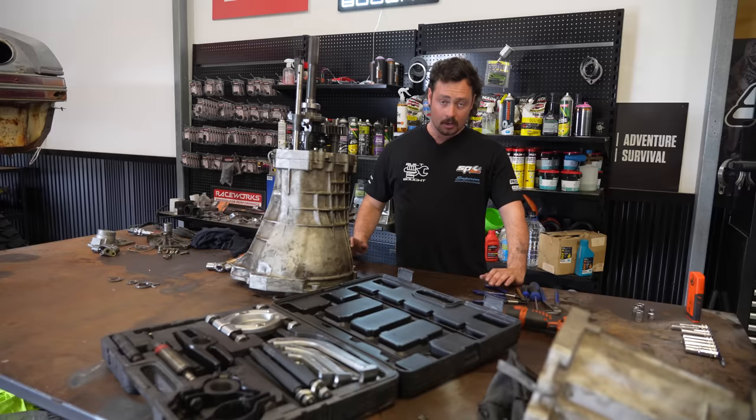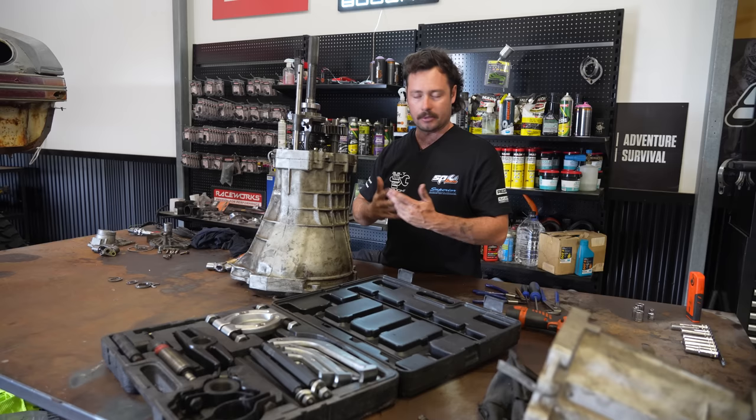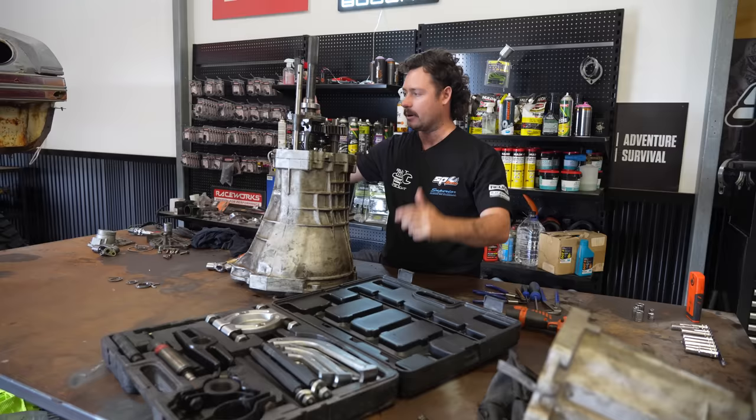Okay, now a couple of these bearings look like they're going to be a slight interference fit. They've either been pressed on or heated up and dropped on, and they've kind of sucked on. Gave them a little pry, but without too much pressure, they weren't popping off. So, got the bearing puller here, which I'll put on with a claw and it will pull that top bearing off. All the locking tabs are off.